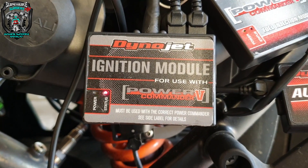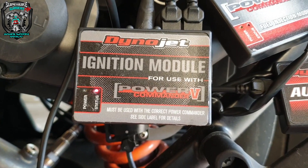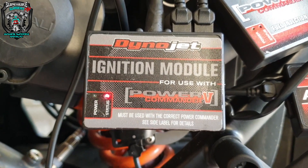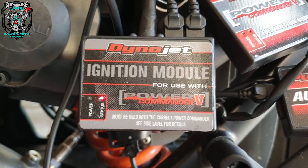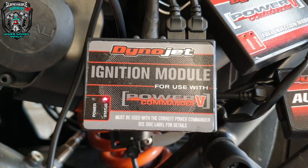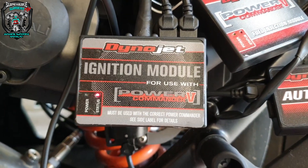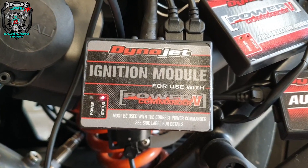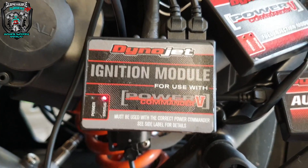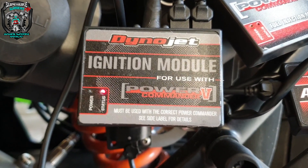It's like it's had enough and rebooted. I was worrying it might be because this module gets its power from the ignition coils - there's a constant live, the coils are ground-side switched so they have lives to them and are controlled with an earth. This module gets its power from the coils, so I was wondering whether it wasn't the module but something else funky going on with the bike.